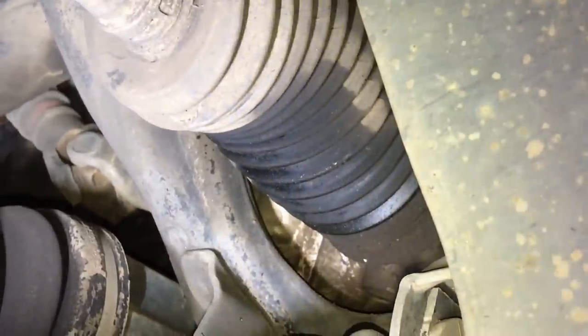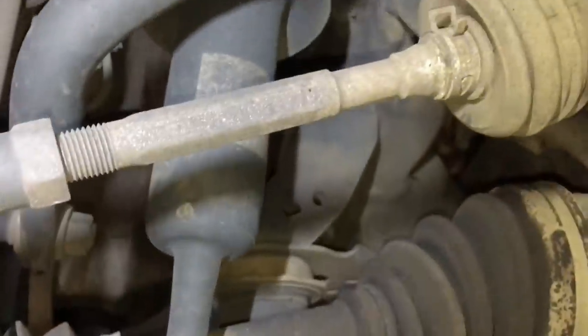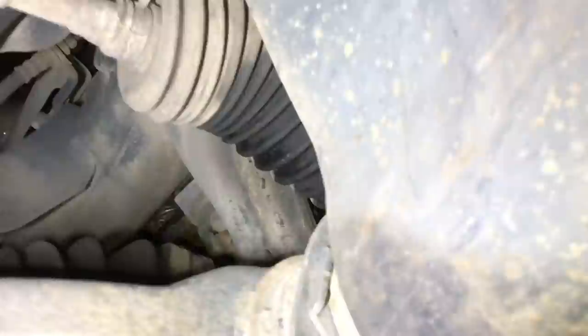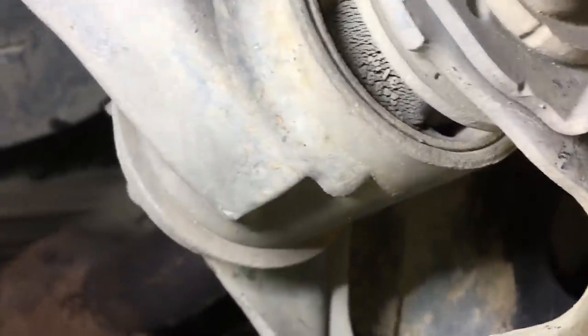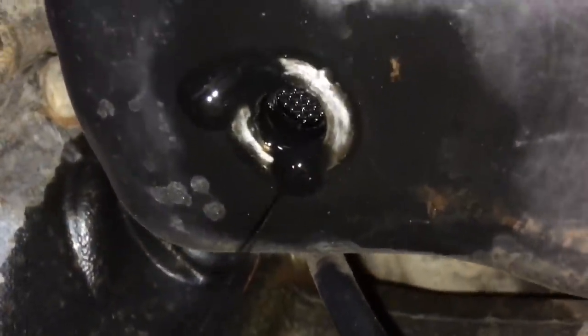Under the vehicle - the usual slight sweat at the steering rack, as mentioned in other videos. Make sure you check the power steering oil level, especially on the 120s. This is on original suspension, so it's going to be flogged and need replacement. Those front suspension bushes are ripped to pieces - and the back one will be mincemeat too.